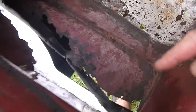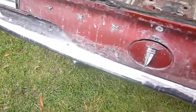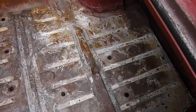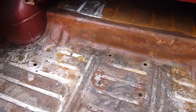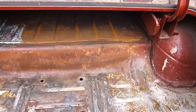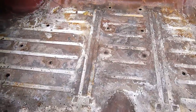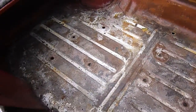It's all just surface rust. I do have some rust-through, and of course I have other issues here that I'm going to deal with afterwards — major issues actually. But the first thing I want to do is prepare the trunk for POR-15. As you can see, just some milky surface kind of stuff there, and I'm going to POR-15 it, which will give it a nice ceramic-style finish.